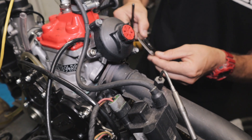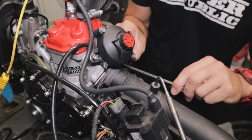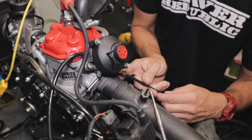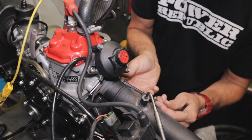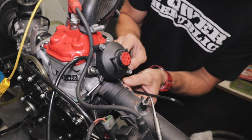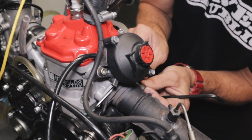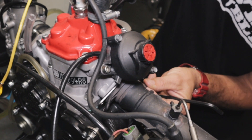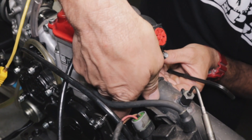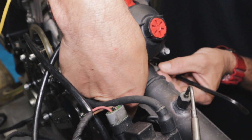This class was introduced maybe 10 to 12 years ago and it's really popular here in Australia. Each engine type has one of these plates to give parity between all the 125cc engines — the IAME X30, obviously this is a Rotax Senior Max 125, you can use the Junior Max 125, and the PRD Galaxy also has one. They've all got different sized restrictor holes to give equal performance depending on which brand you've got and the weight category.